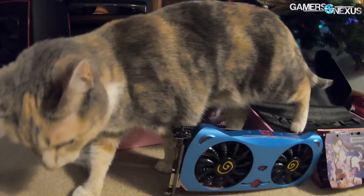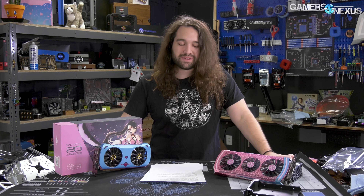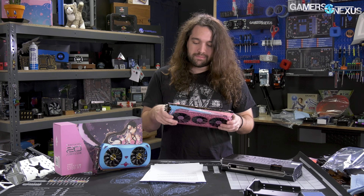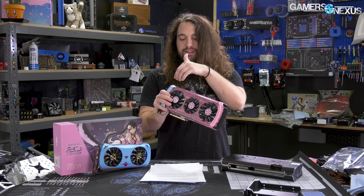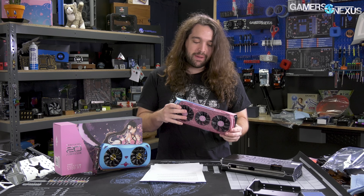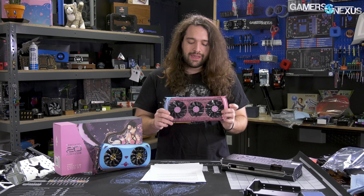The card really is not worth it, to be frank. At $500, it's not worth it. At $700, it's worth it for us and nobody else, unless you're making money off the content somehow. The card is strictly not good. The cooler is not efficient. It has all the same problems as the XFX Thick — namely, a big plastic shroud overhanging the most critical part of the fin stack. The fins are oriented up to down, and the top layer spits air right into that shroud, trapping a lot of heat. With the XFX Thick, we found that removing the shroud had the biggest impact on performance improvement. The same would be true here.